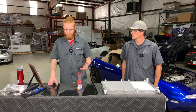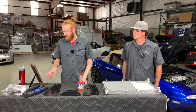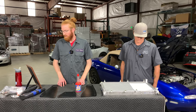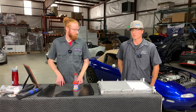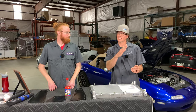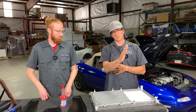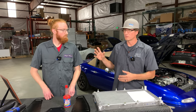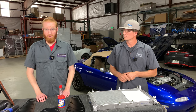In our experience, when you get to about 225 to 230 degrees, that's when you want to shut the car down and let it cool. Typically anywhere between 200 to 212 degrees Fahrenheit is fairly normal for these cars. If you're turbocharged, even a little hotter than that can be pretty standard. Once you get past the 220 degree mark, it's definitely time to find a place to stop and let it cool down. With stock gauge clusters, the needle typically stays around 10 or 11 o'clock — once you see it slowly creep toward 2 or 3, that's an indicator you're approaching that 230-degree mark.